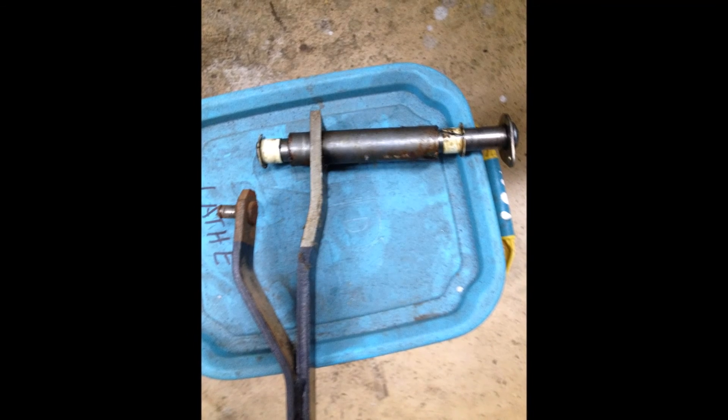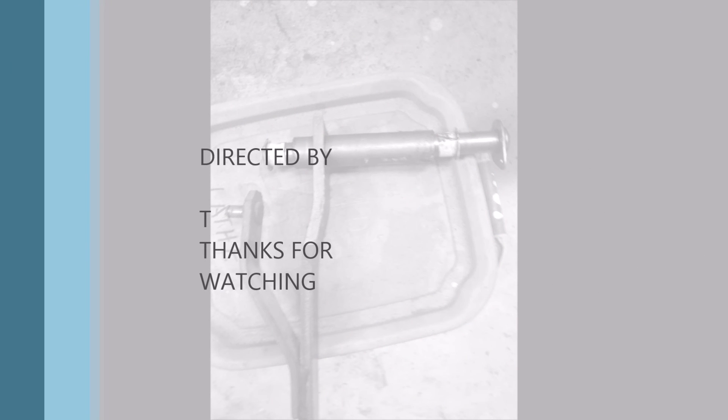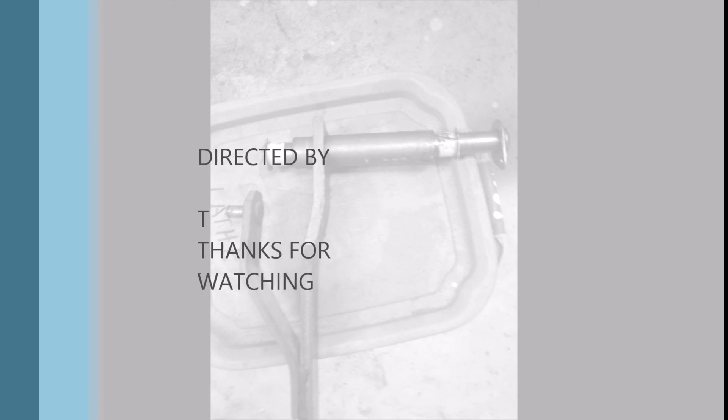You can see the rod end installed and adjusted — you can lock it down. It's very nice to have that adjustment; it should really be a factory install. As a footnote on the big bushings for the hold-down on the clutch pedal rod assembly: I ended up buying those on eBay from a guy who sells Delrin bushings, the good ones. Between those and the rod end setup we fabricated, the whole setup shifts, runs, and drives beautifully — probably better than it ever did. It's a really great fix. Thanks for watching.